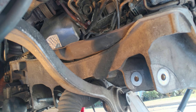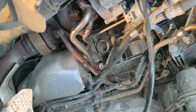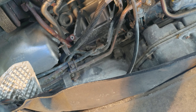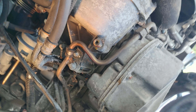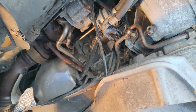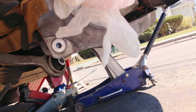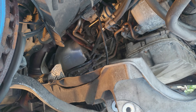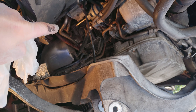The mount is removed along with the whole support — the mount sits in a support that is bolted to the engine. There are about four bolts: one, two, three, and the fourth one is hidden up there somewhere. I'd just like to say lots of words to the designers because this is ridiculous. Anyway, I dropped the subframe — as you can see, I left one bolt on the other side because I'm doing one side at a time. I don't want to drop the whole subframe at once.